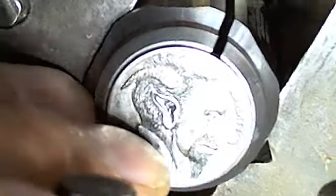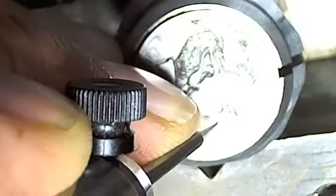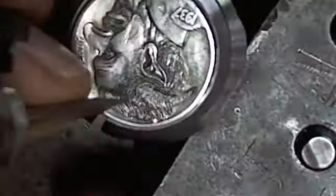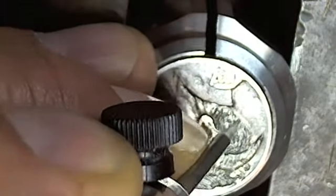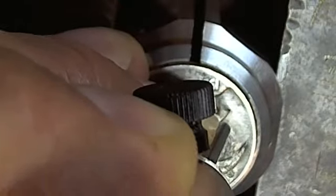This is one that has a little tooth to it, so this is going to push the metal. Turn the light down a bit, maybe a little less light, and now you can see that better. I'm sorry. So here, a big scratch going through here. Let's see if I'm on the camera. The scratch. So I'll come here, and I'll just buzz right over that scratch. Erases it and smooths it out.